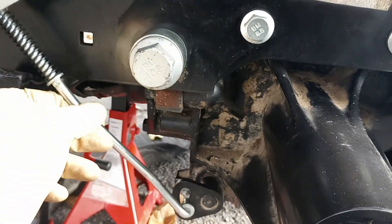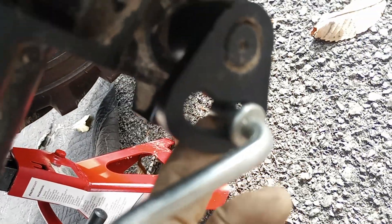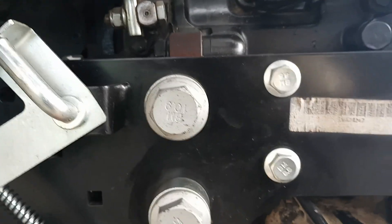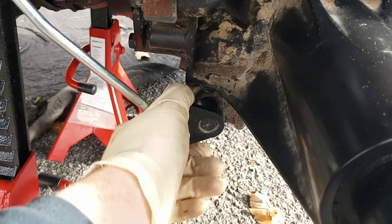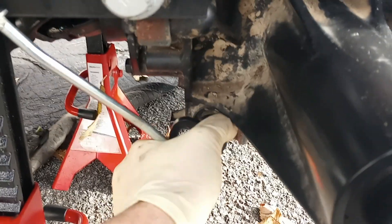Another thing — come back here. This rear differential linkage is super loose. This is how they all are. What I've seen a lot of people having issues with on the forums is — and it was on this one too — this beveled end here, this edge right there, gets caught up in this linkage and locks your diff, essentially. The other thing I noticed is that your brakes are attached to this differential lock. So you can see even my diff lock is not going down all the way — rather, not going up all the way into the off position — because your brake linkage is not adjusted right.